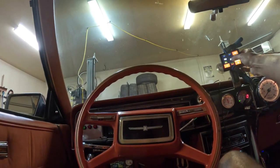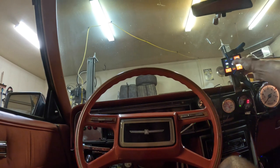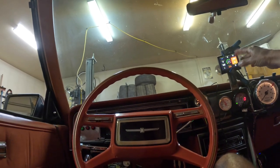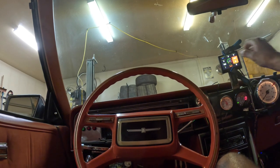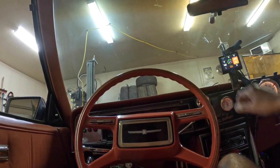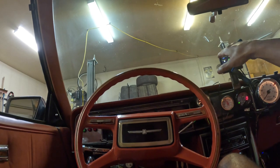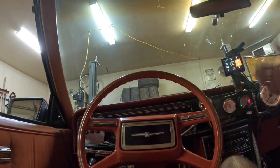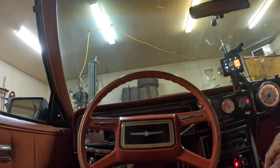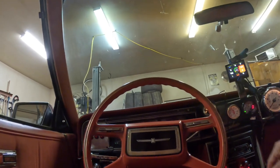So you can change how this looks and what's displayed here - it's actually pretty simple. We have dash three which we're just looking at, and dash two which shows my transmission temperature and boost gauge. I've also added a speedometer and miles per hour, which tells you what gear you're in. Here's line temperature, transmission 102 degrees F, lockup status off, and pedal position up here. These are all called channels and we can change all this to show what's most informative for our particular application. Right now pedal position is zero - if I press the gas it moves, and if we go to the floor it reads 100.